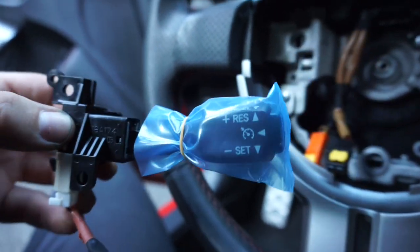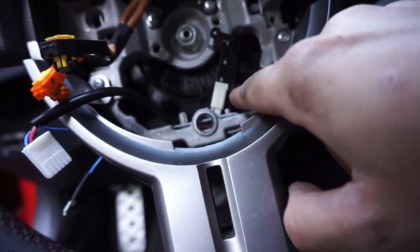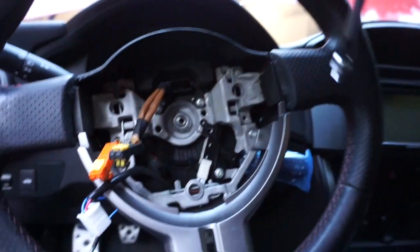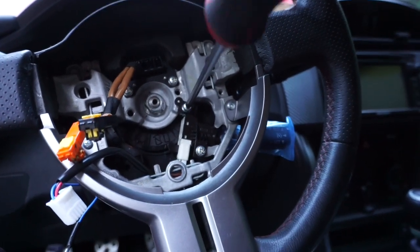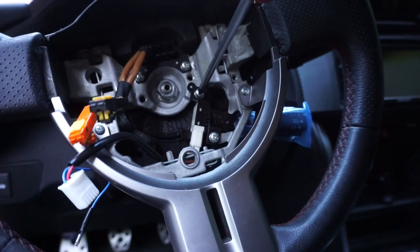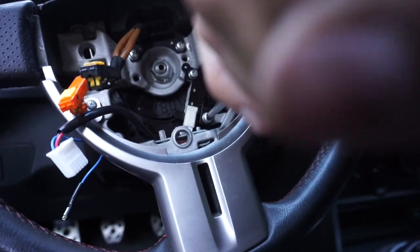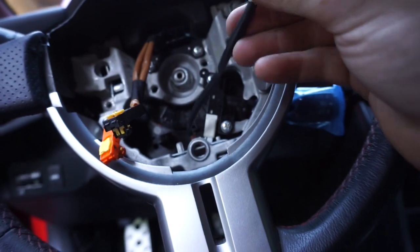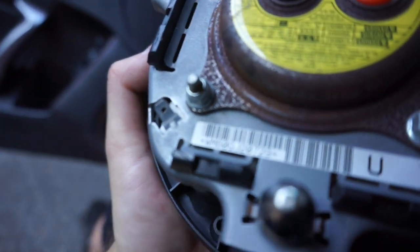The way I got it out is I just slid it like that. The hole will come out right there. I do recommend leaving the blue plastic on before getting it mounted so I don't scratch it — the new up-down and set for cruise control. I just weaved it through here. Here's the new cruise control. I got one Phillips head in and now we'll do the other. I do recommend using a Phillips head with a magnet so you don't lose the screws. OEM spec is just tightened to the end of the Phillips head — they're not torqued heavily at all. Now let's plug this up to the clock spring right here on the airbag — you can see it perfectly mates up.